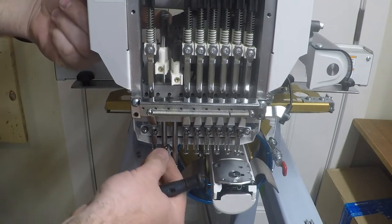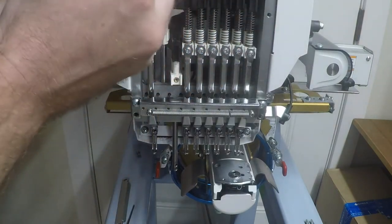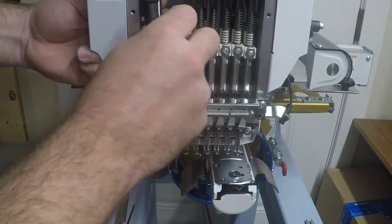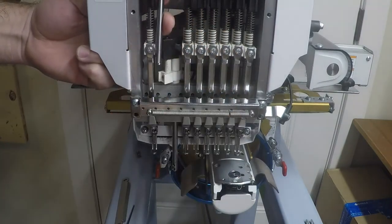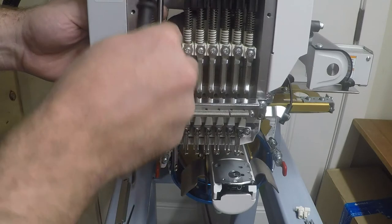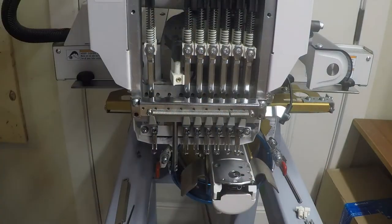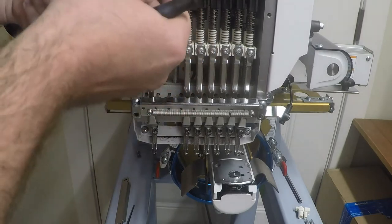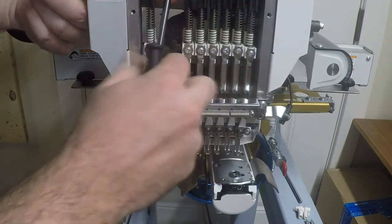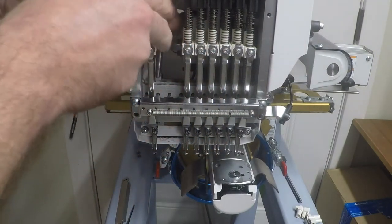The reason for doing two of them at once is because you need the room to turn this 90 degrees to get it up through the top. Pull on it until it comes out, remove the presser foot clamp, set it aside. Turn it back again and pull it out the back of the head — that's the whole reason for having the head turned to the side. This one comes up through the top; pull the clamp off the bottom, set it aside, then pull that down and through the back.